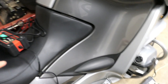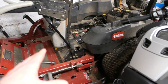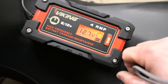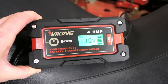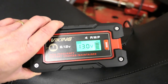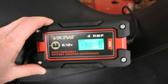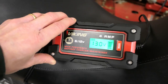For the next test, the bikes are all charged up so I found a lawn tractor — a zero-turn mower — and that battery is slightly discharged. It's a 12-volt battery at 12.16 volts. So let's see how this thing handles that — and it is charging, showing red, so it's attempting to charge it. The elapsed time for charging this mower was about 25 minutes, which is impressive. This is a 4-amp charger, a little more than these older chargers which are 1.5 amps — so this new unit is improved in readout and options, but also higher powered, meaning it charges more quickly.